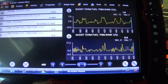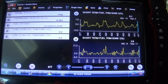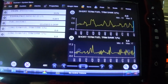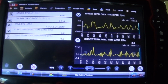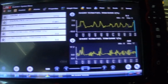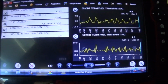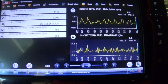Now, why is this happening? It's because when I shift in the gear, you can see my upper engine mount is completely shot. So when you shift the engine in a gear, it moves the engine physically, and then it will open up the gap momentarily on that boot, suck more air, and then the engine goes back up, and all of a sudden you have the shift in fuel trim. It makes sense, but my point is, if something like that happens, your next step is to get out of the car, look under the hood, and inspect those places where air is getting into the throttle body.